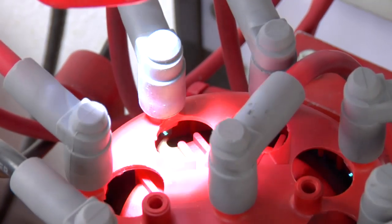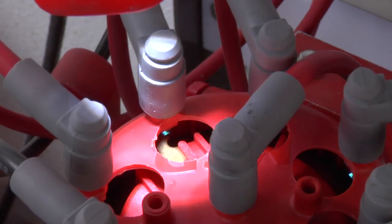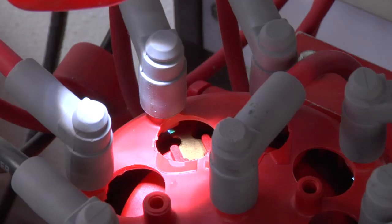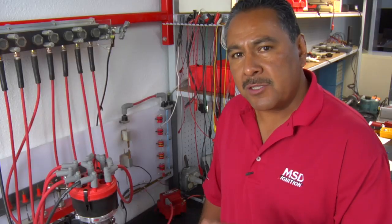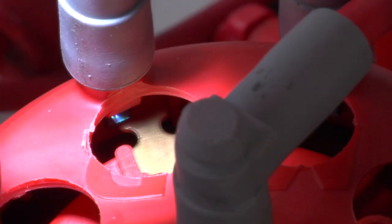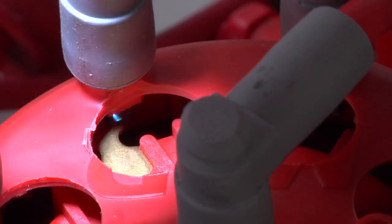In order to adjust it you may have to do it a couple of times with the timing light to get the right location. You can use your eyeball to get close first, but with the timing light it'll verify, and then you may tweak it a couple of times. You want to have the rotor in close proximity to the distributor cap terminal at all times, depending on the span of retard that you have.